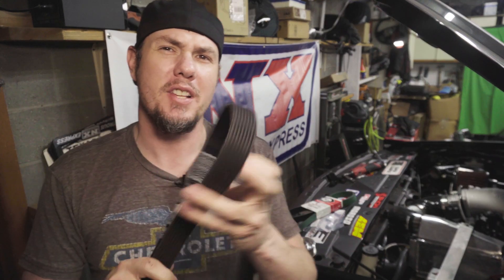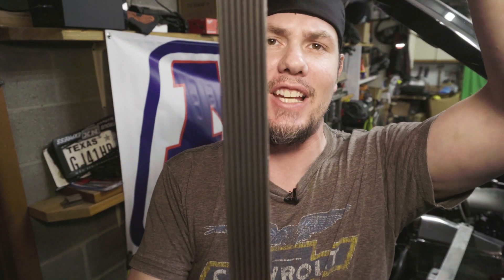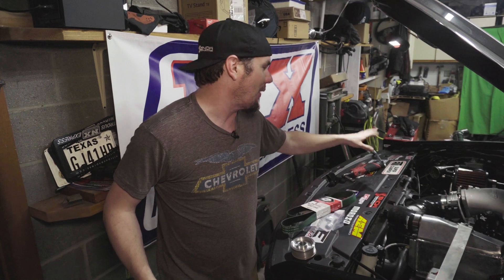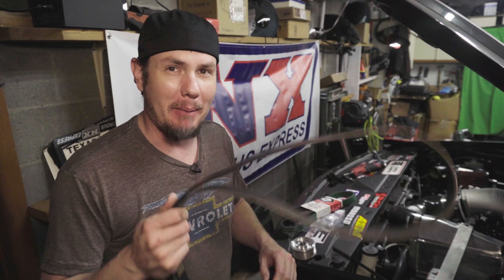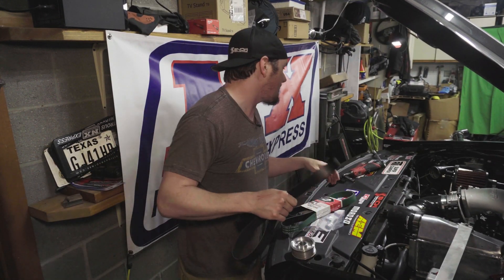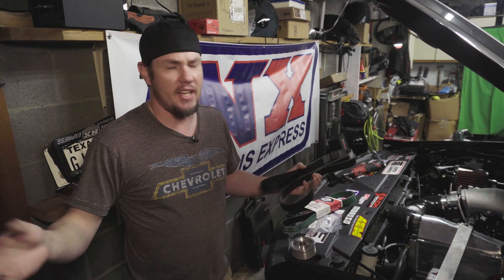This belt is the one that's been on there for not too long, but you can see this belt doesn't have any glazing, so it hasn't been slipping. Another telltale sign: if you look around the head unit itself, you will see dust around the pulley — that black dust is literally the belt deteriorating. If you see a lot of dust building up around the pulley on the blower unit itself, that's another good indication. Boost is always the best indication though, especially on these centrifugal ones — if it's fallen off, you've got belt slip.